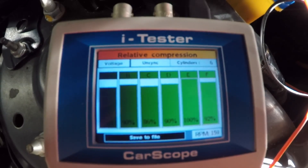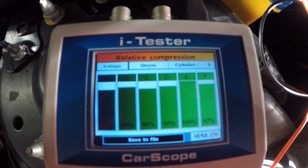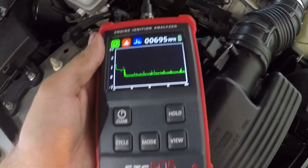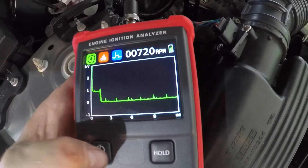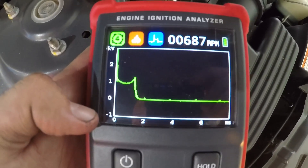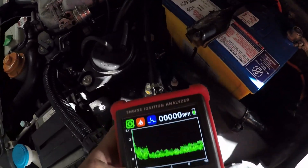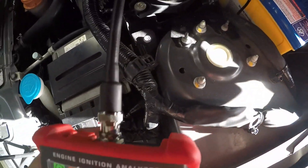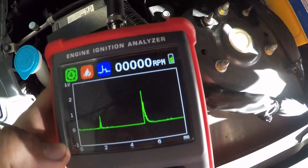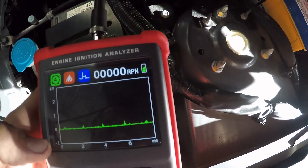What we're going to do next is get the GTC 505 and go over all the coils to see what our spark looks like, then we'll make a decision on what to do. We're hooked up and running - let's wave the GTC 505 around. There's a little bit of static but we're going to look at that. The next one looks okay, next one looks okay, back one looks okay, looks okay - number one, the culprit. We have got absolute randomness here; something funky is going on on this one.